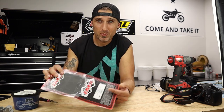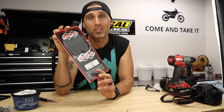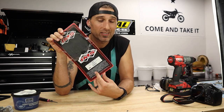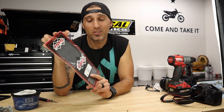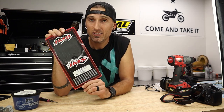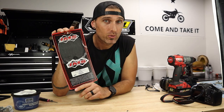This foot peg video applies specifically to the 1989 and presumably the 1990 RM125 and RM250. We missed full bolt-on status by just one year — in 1991 IMS came out with pegs that bolt directly onto the RM125 and RM250, 1991 through 2002. These also fit the DRZ400 from 2000 to current. IMS sent me these pegs thinking they'd work on this bike; turns out they don't, so it was great to work with them and show them what to drill so they can help other people with '89s and '90s.